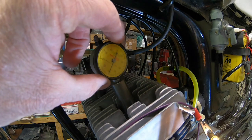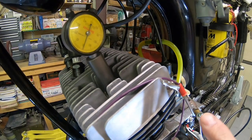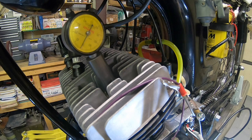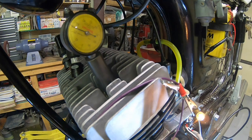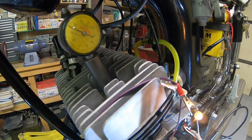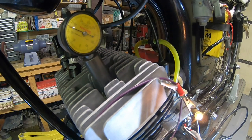Okay, that's it right there. Now I'm going to go the other way. There's one, and there's 1.8 right there. Now I've gone on past. Now I'm going back in the direction of travel and also keep an eye on the light right here. I'm actually just a little past it — about four, I guess. Something like that. And that's when the light comes on, that's when it fires. And that's the left side.